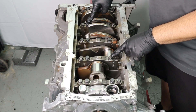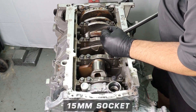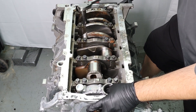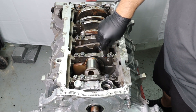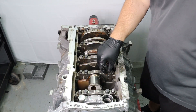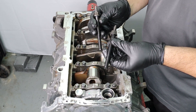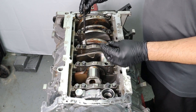Here we're going to show you the positions of the main cap bolts we need to remove. Here is the diagram from Ford — it's positions 14 and 15 in the torque sequence. With a breaker bar, go ahead and pop them loose and get them out of the way, because we will be replacing them with the supplied new main cap bolts that have the studs built into them. For this part you'll be using your 15mm socket.